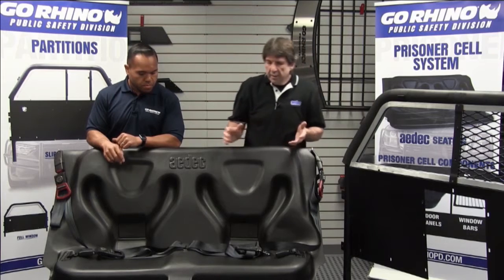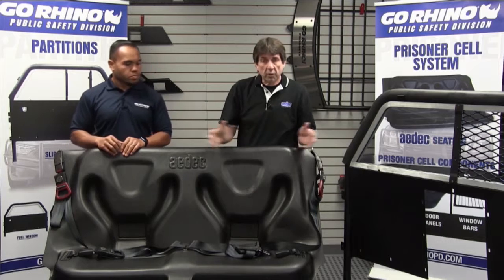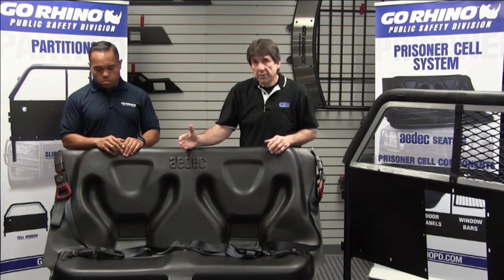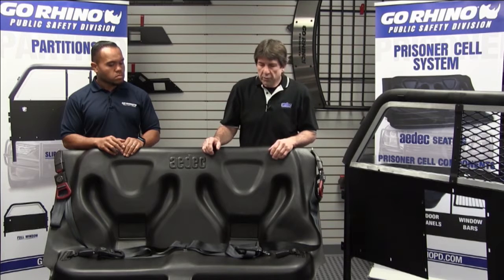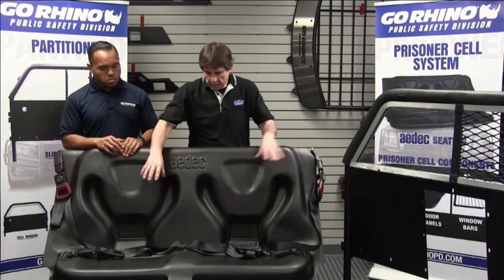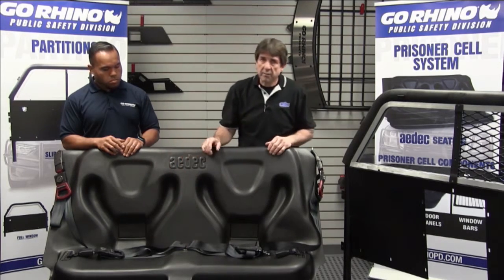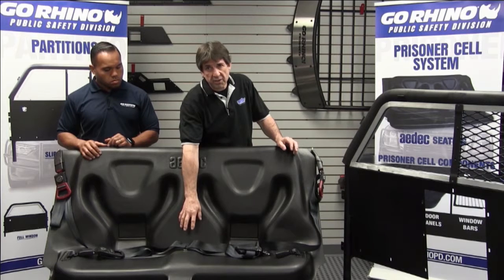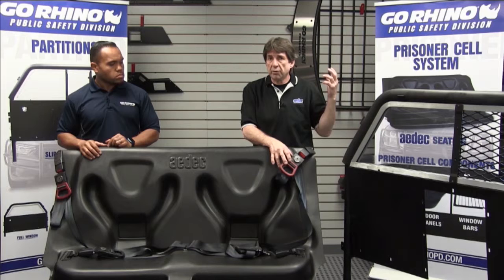Thank you for having me. We're going to take kind of a 10,000 foot view today on installing the seat. The first thing you're going to do is get the OEM seat out. Depending on whether you're going to put in a factory belt or a center belt, we may have to strip back the seat pillars. If we're doing a factory belt, we're going to leave the OEM seat belt in place, and our buckles are going to be up on top of the seat in the center using the factory seat belt. If we're doing a center belt, our belts are going to originate out the center and we're going to put a buckle in the OEM position where the shoulder hoop goes.